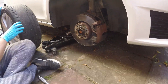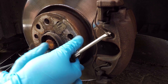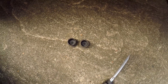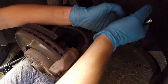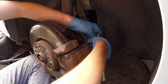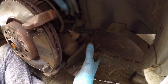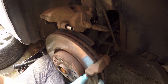So we're on to the front now. You've seen the rears — we're going to go ahead and take the wheel off like you've just seen. We're going to take off the caliper carrier, starting with this caliper retainer clip here — just pops out. The slider bolts on the back of the caliper have two plastic covers on — just take those off and it gives you access to the two Allen key bolts behind the caliper. Helps if you do it anti-clockwise — easy mistake to make when you're working backwards sometimes. Taking the caliper off now so we can change the pads and the disc. After a bit of work there, the caliper is off. The pads are worn — there's only about a mil on that one on the driver's offside.